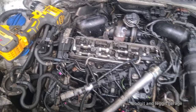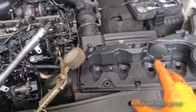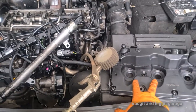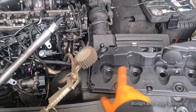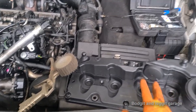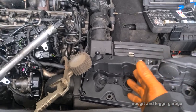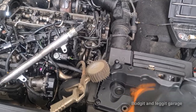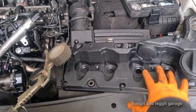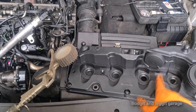I'm going to put the injectors on. Because I was absolutely smacking on injector number two for a long time trying to get it out, I'm going to move the two we know are good and put them on positions one and two. The one I was smacking on is going to go on three or four, and the new one will go in one of those positions. I don't really want to be undoing that repaired bolt too many times — I just want it seated and left there.